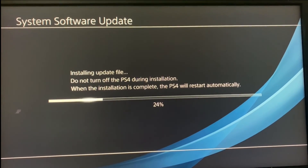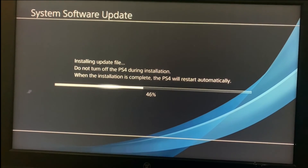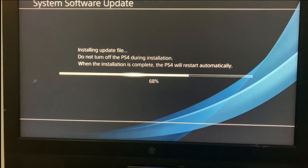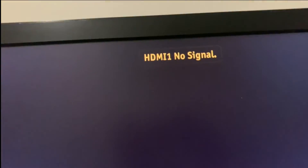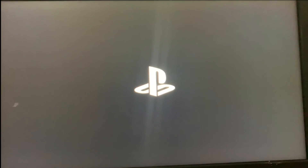Let me repeat one more time what happened. The PlayStation 4 was not able to come up and upgrade itself. It requires files from the website. We downloaded the file, formatted the USB stick in a specific way, put the files into the USB stick, brought it to the PS4, plugged it in, and restarted. From that point on, it does its own thing and restarts a few times, and finally it shows you the PlayStation and Sony logo. If during the process it shows you some disturbance of the view, do not worry and do not turn off the PlayStation — just let it do its own thing.